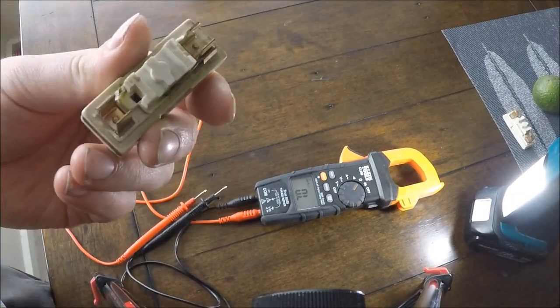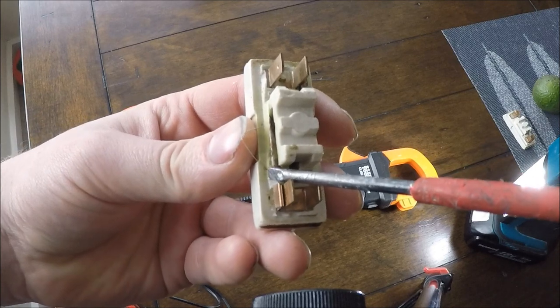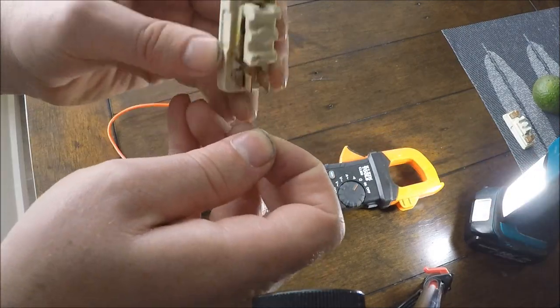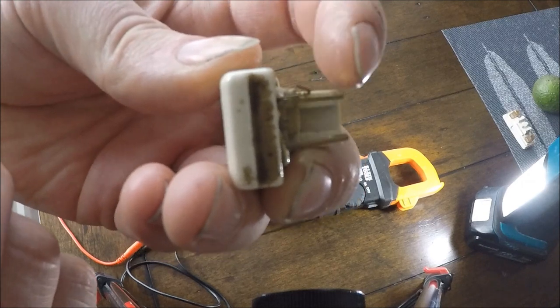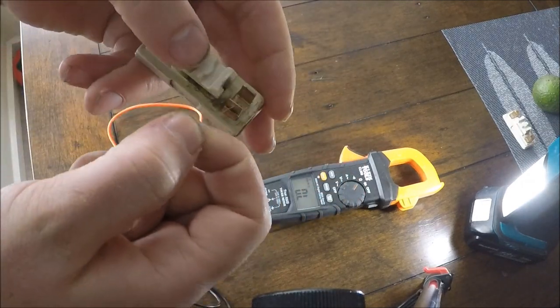This fuse here — we'll check the fuse wire on it and pull it out. Look at that, it's broken on the inside. Pull the fuse wire out. Be careful that you don't go pulling this copper tab away from the edge there — as you can see it's hard up against that. Same as for this side.